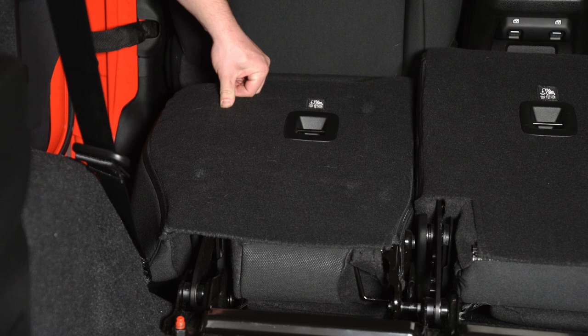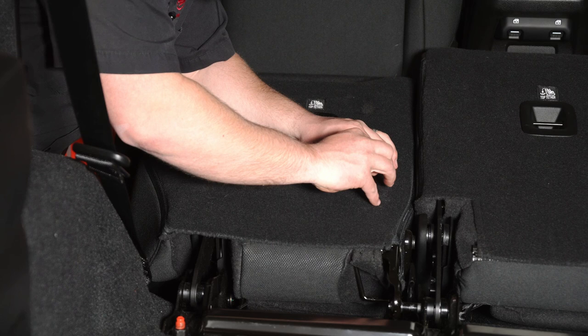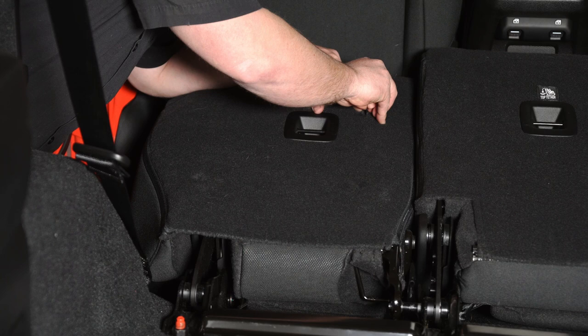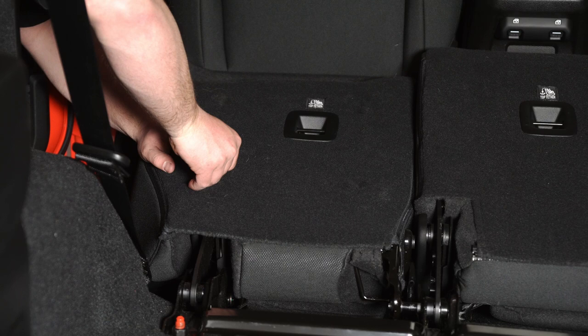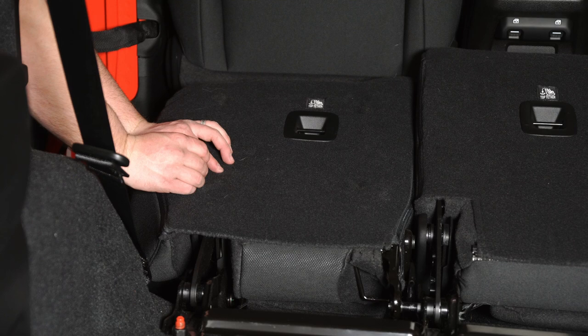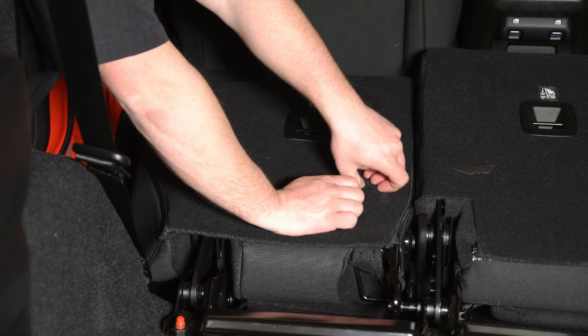What I like to do is grab yourself a razor blade. Once you're 100% sure you have the spot, just go ahead and cut a little cross in there. You can feel the circle underneath and confirm you've got the right spot. Once you have them all cut, take the blade and you can feel how far you need to go to the edge — you'll hear a squeaking noise from hitting the metal. Then what you want to do is peel up the little corners and cut them off with a pair of scissors. Just reach your finger in there, peel up each corner, cut that off, and then we can install the grommets.